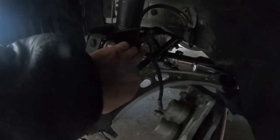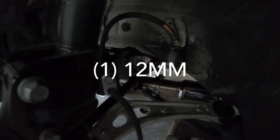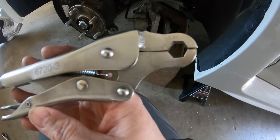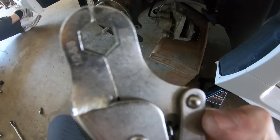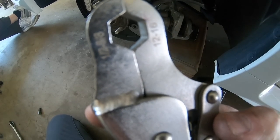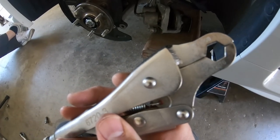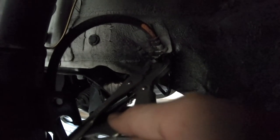Next thing is knock out this 12mm that's holding the brake line down, and then we can do the flare nut job, spill a bunch of brake fluid, and get the new calipers on. I got this flare nut vice grip online - I'll post a link. It's 12 to 16mm, pretty sure that's the size I need in here.